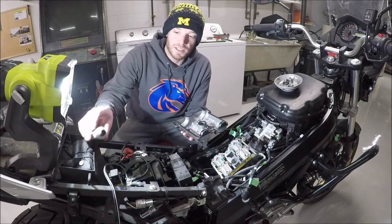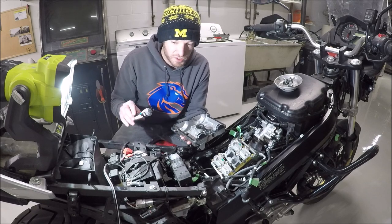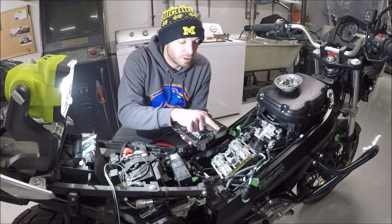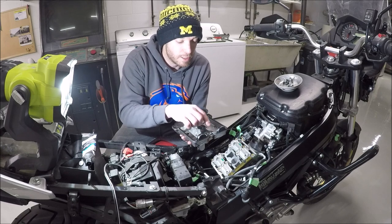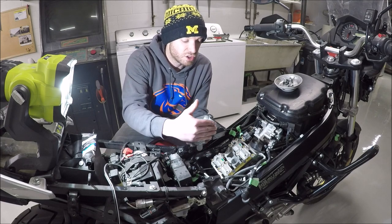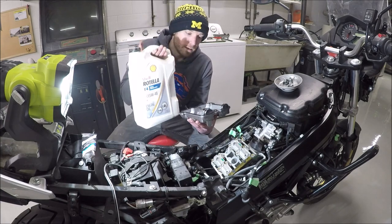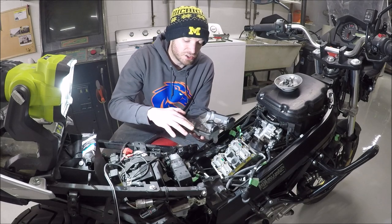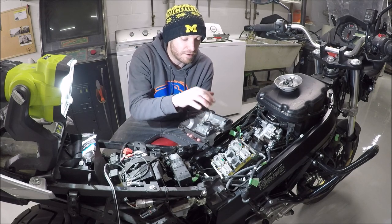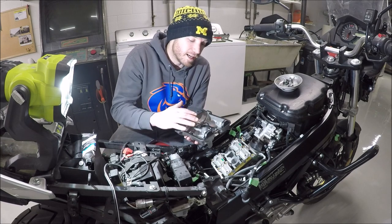What we want to do here is grab a little bit of your Honda Bond — which is the same as Suzuki Bond, Kawi Bond, Yama Bond. The important spots are at those four corners where the flat plane meets the half moon. I'd still put a light film over the half moons. Just don't go nuts on it, and if you want to be heavier anywhere, do it towards the outside so when it squishes, it's squishing more to the outside — you don't want stuff falling into the engine. Then grab a little motor oil and wet the outside of the gasket all the way around — it'll help it seal.